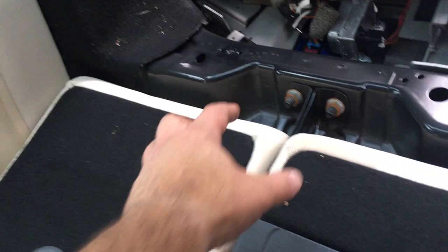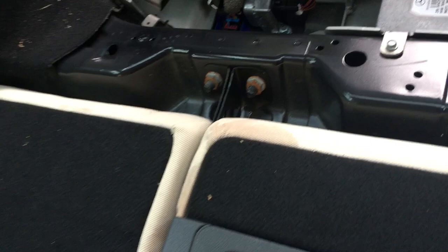I stand corrected - there are two more bolts under here. It looks like on the side there's no bolt because there's actually a metal pin or stud that just enters into a sleeve, same thing for that side. So you just have to disconnect the middle bracket. Unfortunately, even though it's only one window I'm working on, you've got to remove both seats or at least remove the anchor for both seats to gain access.